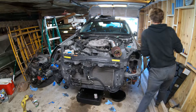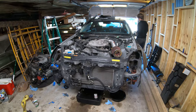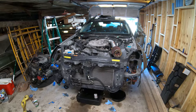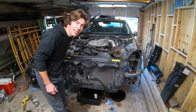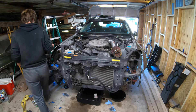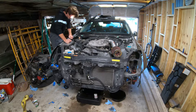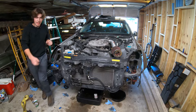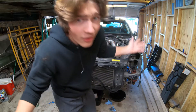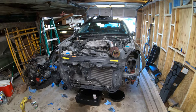I don't know if it's even going to do anything - I'm just going to run it for a couple seconds. Well, it didn't start - no click or anything. I think it could be the parking position sensor, that's probably what I'll try first. It's either that or not having the clutch engaged. I don't know if I'm going to be able to figure it out today so I guess I have some work to do.